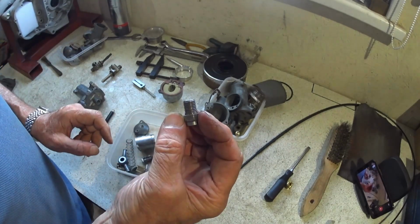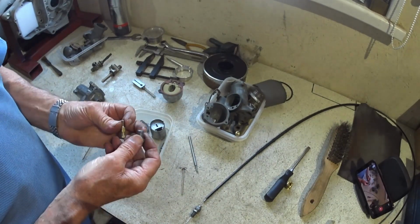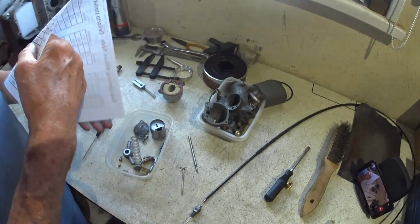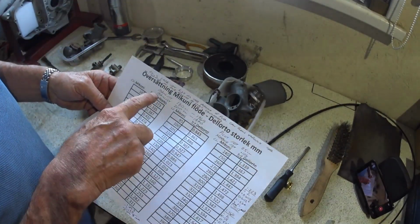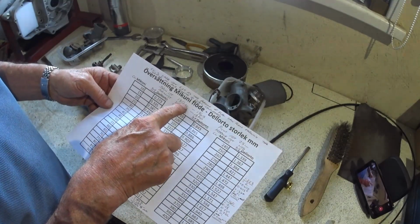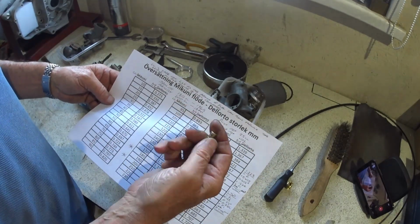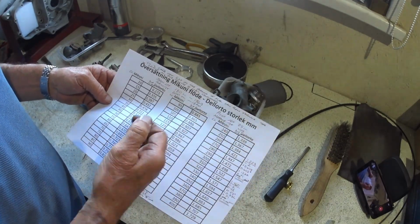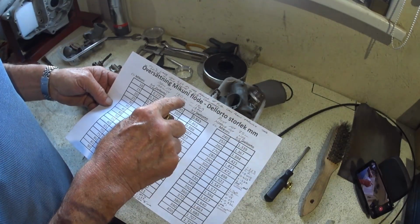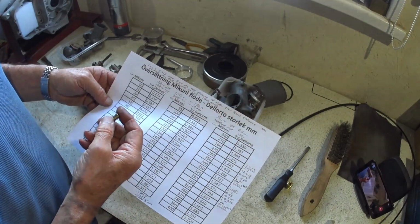So we need the jet holder and the two jets. So we've got the main jet, and I did have a look in a couple of the manuals. So for a 1969, which this one is, it's a 180cc jet. The 180cc's got nothing to do with measuring the hole size. It's actually in 1 minute, 180cc's of fuel can pass through that orifice.